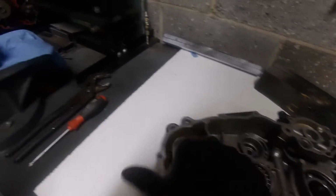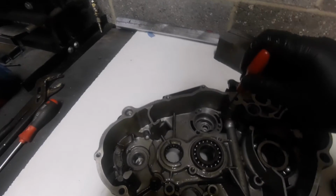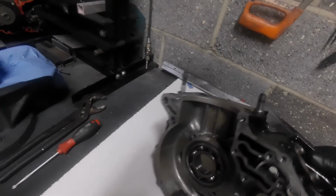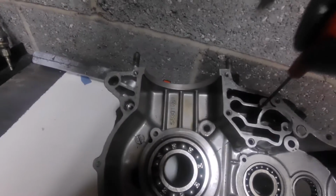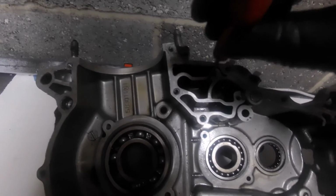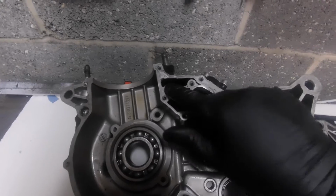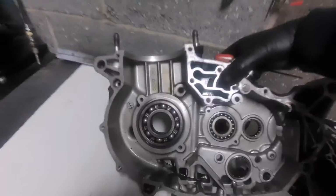So as it's now going down there, if we move our oil pump components, we're now pressurised oil here for the engine's workings, for the cam, for the rocker arms, for the crank, for the big end, and everything is fed out of that chamber there. This is the all important one. Okay, so there it is, and the corresponding one at the back, I lay it on that bit of a block of wood now, is here. There's the slot at the back into this chamber here. Remember, the plate's blocked it off, so it's just a chamber. So essentially it fills up in here, then it goes that way because it's been blocked off, and now it goes that way.